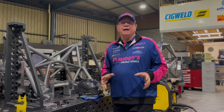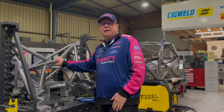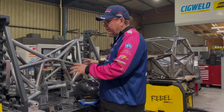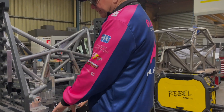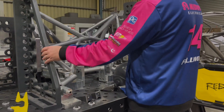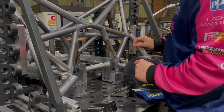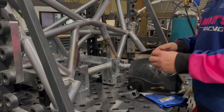Post Sydney Motorsport Park, we've got a little bit of work to do on the rear of the car. This is the rear clip out of car 14, and we've got it on our jig. We got the jig system from Hare and Forbes, and we bolt all these brackets on it, then we mount our rear clip in here, and we're cutting off the trans-axle mounts.